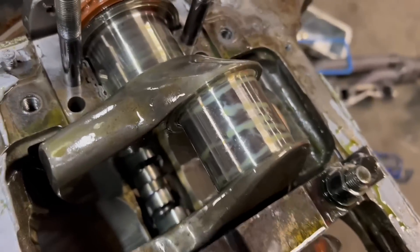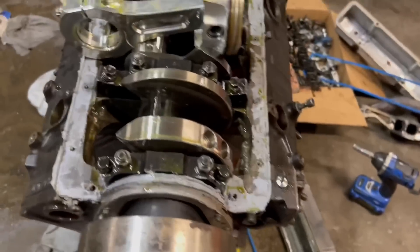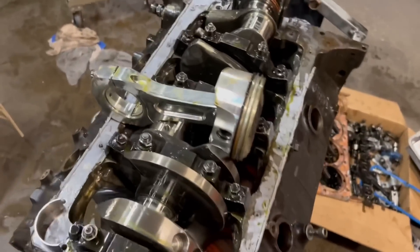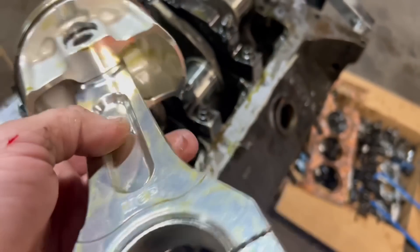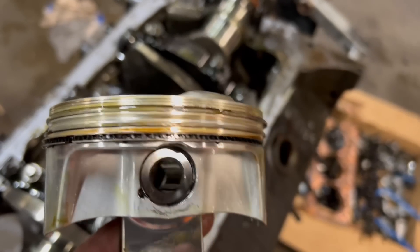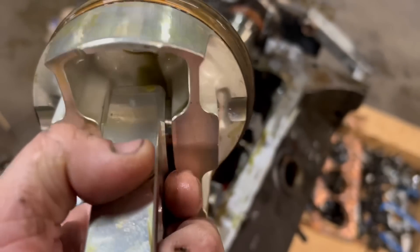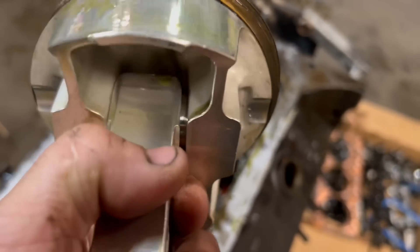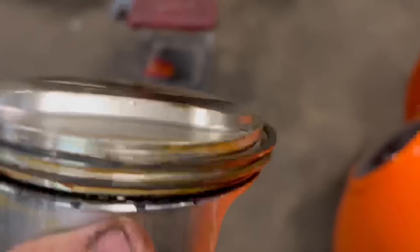All the crank journals look fine. This is a very nice billet Bryant crankshaft — I got it off eBay for $600, it's an old sprint car unit. Running MGP rods with about 200 passes on them now. CP off-the-shelf Bullet Series pistons — we did upgrade the pins, I think they're 200-wall. The rod slides good. The rings are good. There's not much ring land on this thing, about 190 thousandths, but overall these pistons have been putting in work.